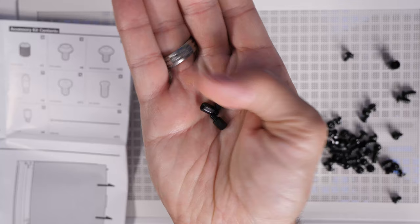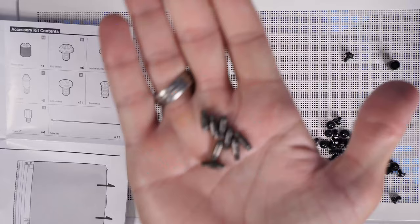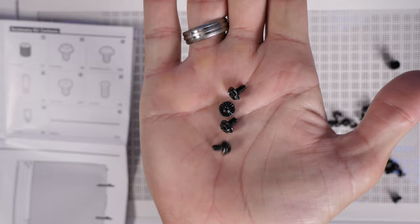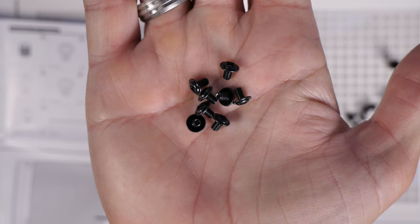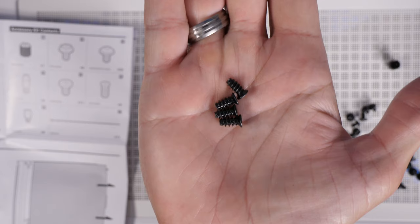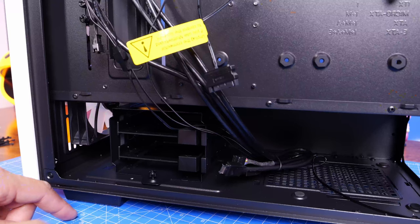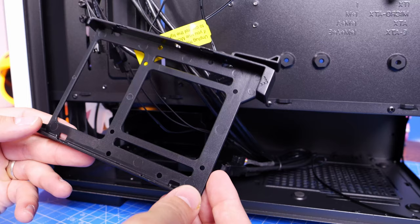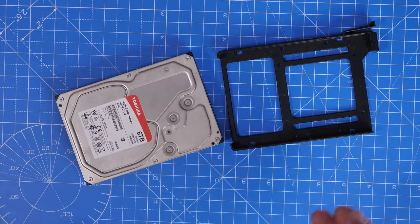Referring to the manual, you'll find: a screw sleeve, PSU screws, motherboard screws, standoffs, SSD screws, hard disk drive screws, and fan screws. The standoff screws are what you need if you want to install a different size motherboard. The SSD screws screw into the SSDs and the mounting points on the case. The PSU screws have a chunky top. The motherboard screws are small with a round top and a cross head. The hard disk drive tray pops out at the rear with no tools needed.